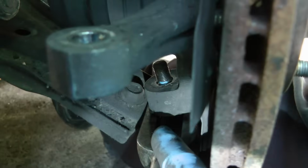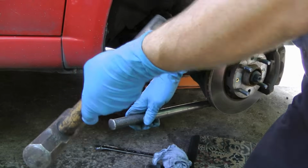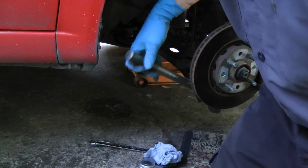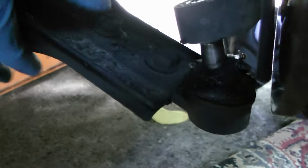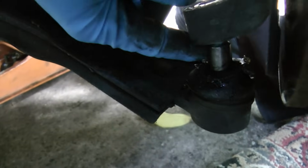Now since the new control arm comes with the ball joint in, we don't care if we wreck the old ball joint, so we'll just hit it off with a pickle fork. The fork's right here. You just put it right under the ball joint and then hit it with a sledgehammer. A few whacks and it'll come right off. And there it goes. As you can see, now it's come out of the hole